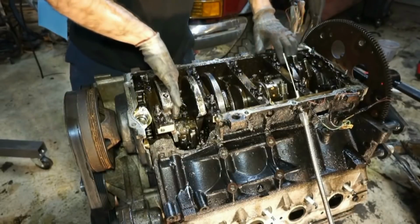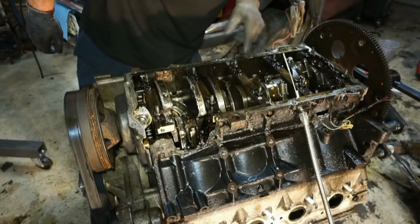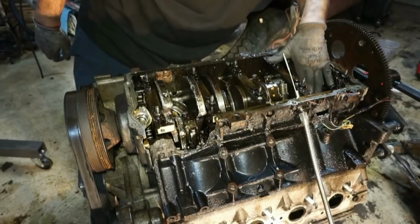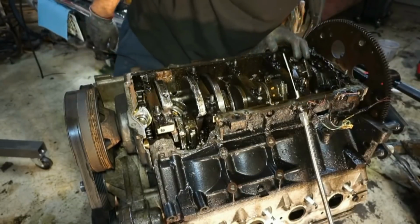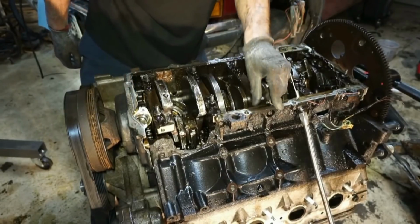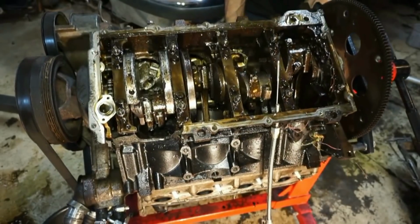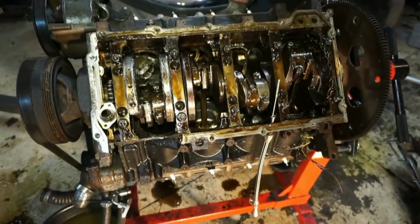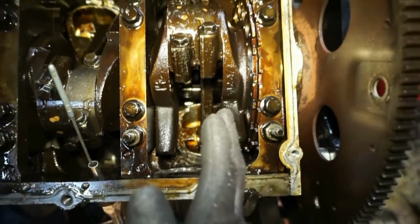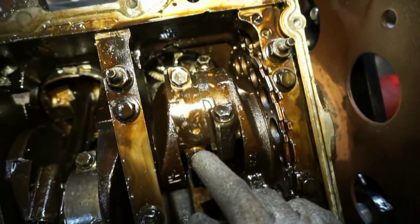So probably around 30-ish pounds of boost. It was already at 16 pounds of boost at 50% throttle the first time I tried it, and then I just decided to go 100% throttle and just go for it. Not a good idea. 2-bar map sensor and decapped injectors, and the table wasn't tuned at all anything above like 7 or 8 pounds at the time. So just a very foolish decision, and it was a fun like 7-8 seconds while it lasted, and I got a ride home.